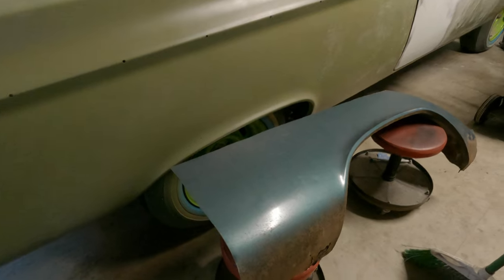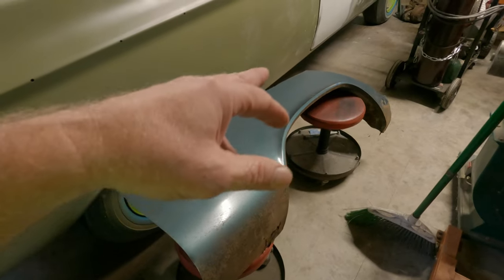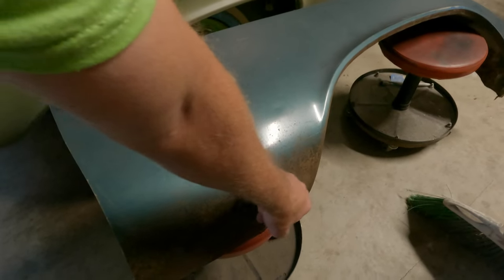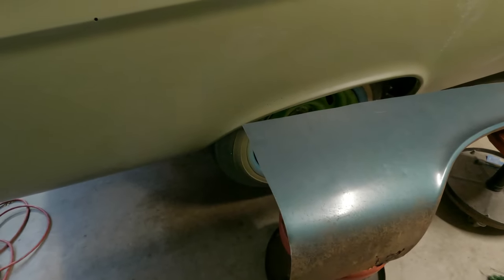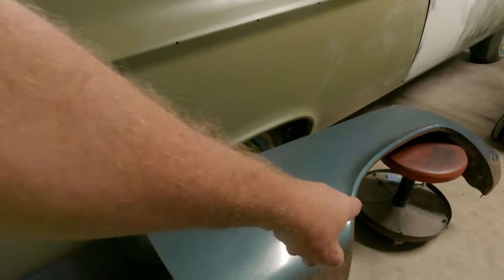I still got holes in my quarter panel. Check this out. Yeah, look at that. Guy named Scott, 4 B bodies only. He had a 4-door, and it's junk down there, and mine kind of junked through there. So yeah, I think I'm going to do this, guys. I think I'm going to use part of it and do this. Yeah, I believe I will. We'll see. That's a big one there for me to do. I think I can cut and butt it. I'd have to drill spot welds out, get the inner structure out of there. Same here. Cut this, lay it over.